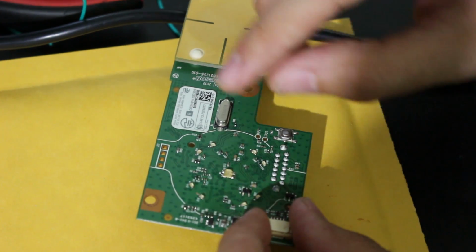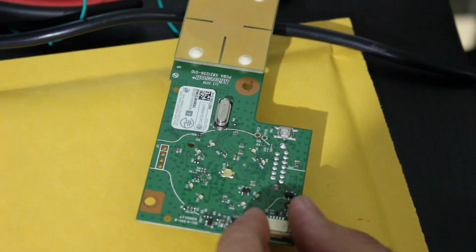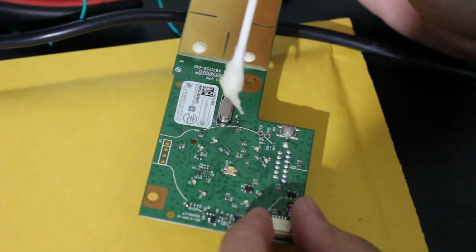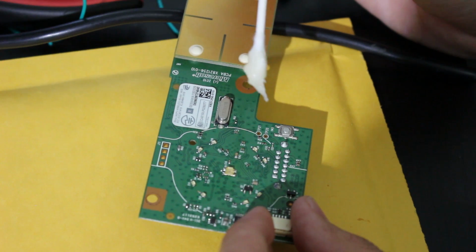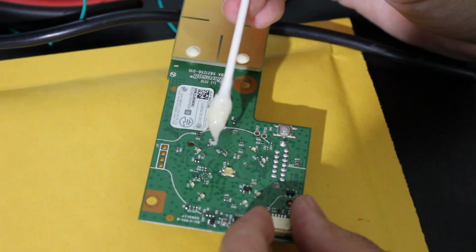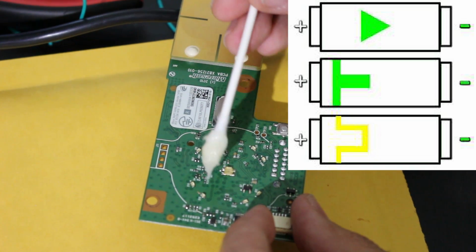I am going to solder. I'll actually tin this right now. I'll wait a little bit, but point is I'm going to flux the point, tin it, then I'm going to solder the negative end of the LED, the cathode we have, to that.